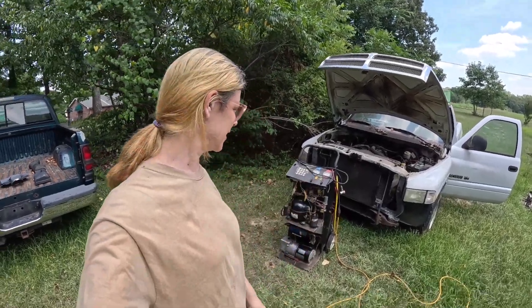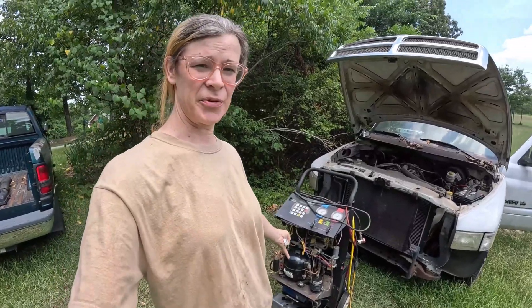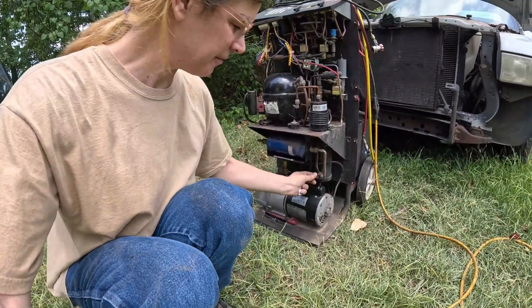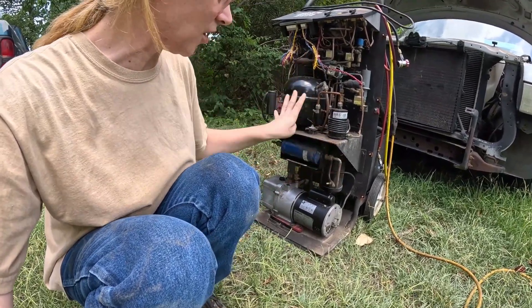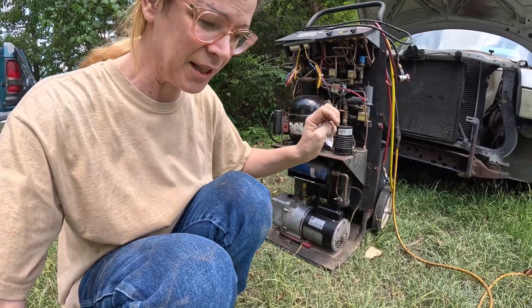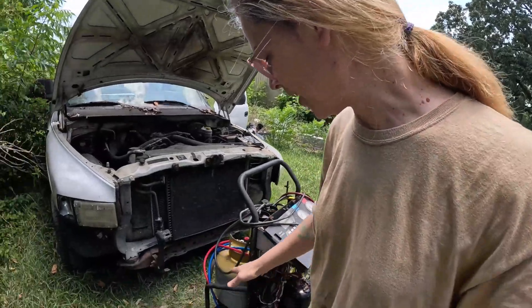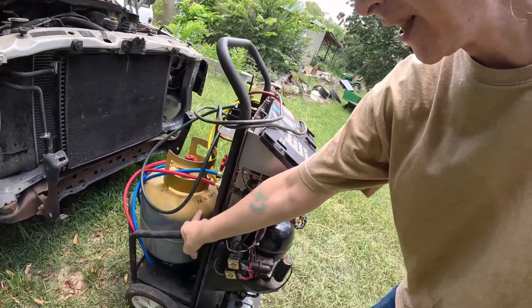It's 90 degrees and it's time to test out my air conditioner recycling unit. I have followed the instructions to the letter. I've evacuated the filter canister and compressor portion, evacuated my empty tank so that it is ready for its new refrigerant — the whole thing is completely empty. I've set the scale, measured the empty tank weight, and marked it. I'll be using R134 for all of the vehicles I'm working on. It's not arguably the best, but it's available, cost-effective, and a good compromise.